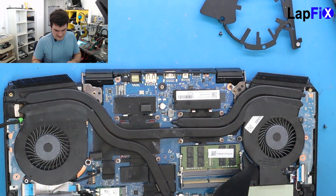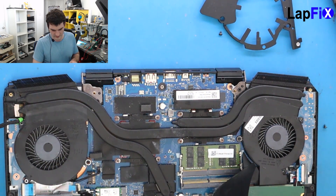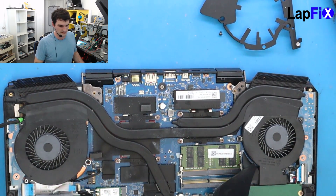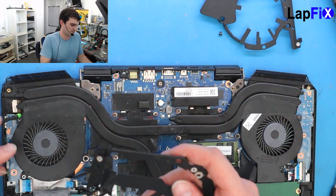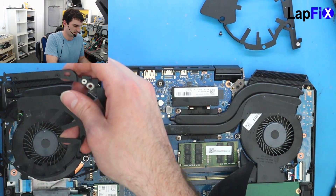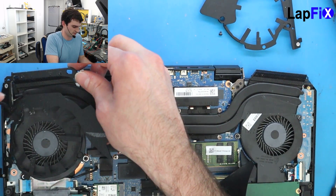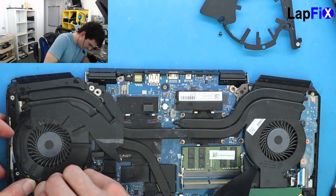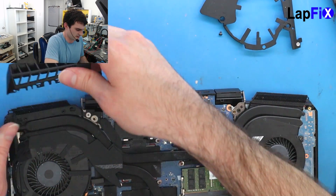Now I'm going to put the M.2 back. This is a little bit of a weird design, so putting the M.2 back is pretty essential. And now it looks pretty good. Remember this part — we have to put this through here and it bends over. You can see how weird the DC jack bends — a weird little curve. I fit it in. That gave me a little bit of trouble, I'm not going to lie. Let's put that in and we can put this on top now.